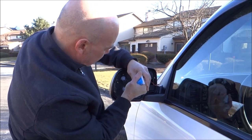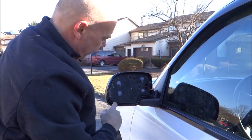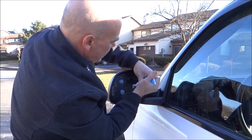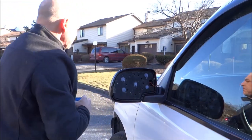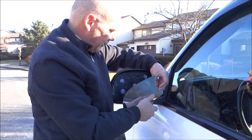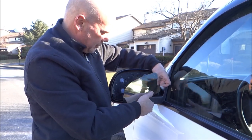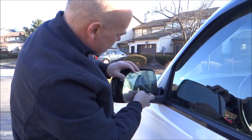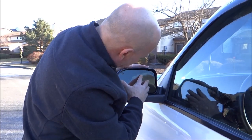Keep the silicone about an inch to an inch and a half from the frame lip so the glue doesn't ooze out. If it ever does ooze out near the frame lip, do not touch it — silicone is very high acidic and you'll never get it off the mirror. Put one spot in the middle as well. We're using about half an inch by three-eighths of an inch. Before you install, connect the power leads first — don't put the power leads in after you've glued the mirror in.